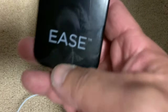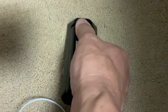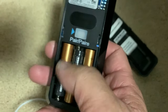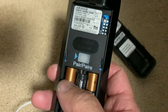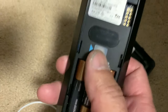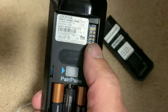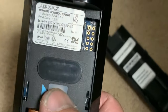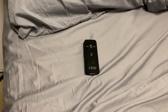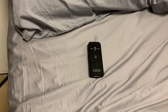Taking a look at the remote control for the Ease 3.0 — how you can tell it's the Ease 3.0 is when you pull the cover off the back, where the batteries are, you'll see this pairing button. Once you plug power back into the unit and the blue light is flashing on the control module, you hold this button down and you'll see the corner light up.